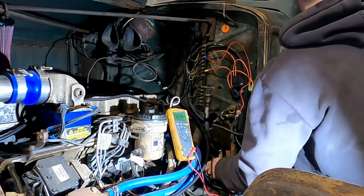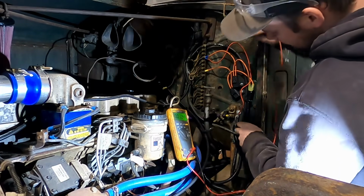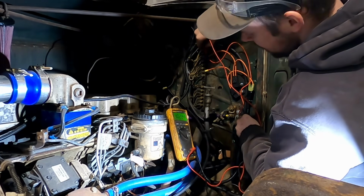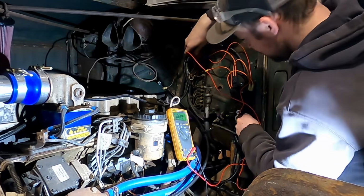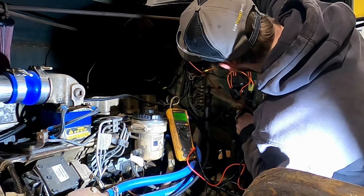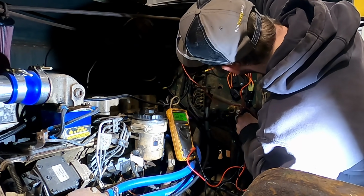Yeah, let's turn the key on. I think that buzzing is the low air buzzer, hopefully. Otherwise something's real mad. Yeah, that's only giving us 4 volts. So we got some issues going on there, either with the key inside... that's 12. And anything else is switched out here.